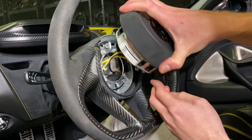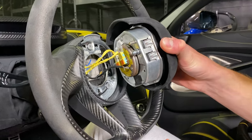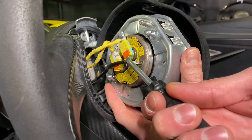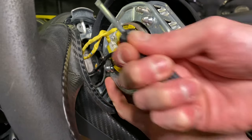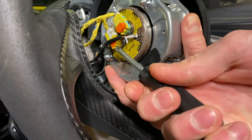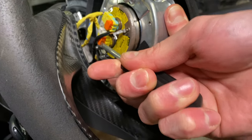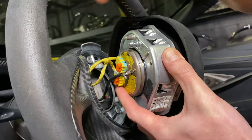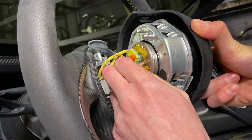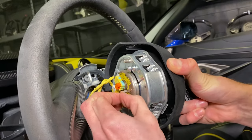While uninstalling it, you can obviously untwist it to give yourself a little bit more leverage. We're going to unclip the back pins on the airbag like we do on every single install. A flathead screwdriver should take care of what you need here — these two pins just pop right off when you put the flathead under the orange part and push up. Both of these are unclipped and you should be able to just pull them out. For the third wire, that's your ground, the black one — you just want to pull it off. There's a little tab holding it tighter onto the metal part, but wiggling it off should get it off as well.